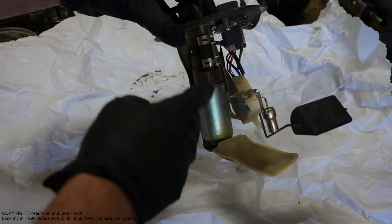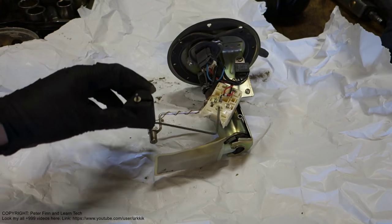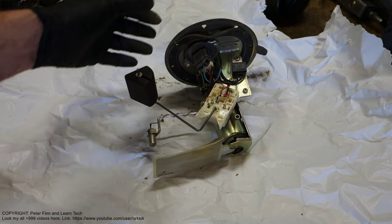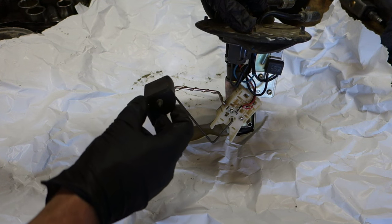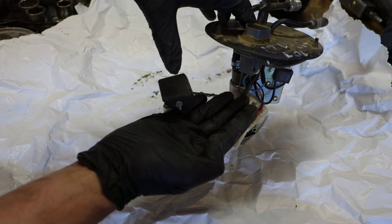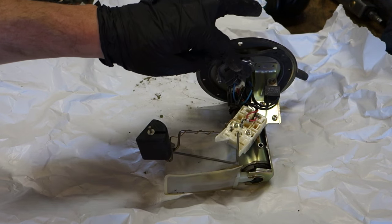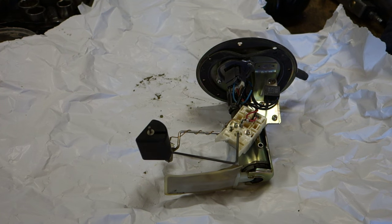Okay, that is the fuel pump, and then what is this? This is really interesting because this part is the fuel tank measurement meter, the sender, in Toyota and any car. When the float moves in our fuel tank, it is always on top of the gasoline level. Like in here, my hand is the gasoline level, and this meter measures how much gasoline we have in our fuel tank. There are a couple of cables that go directly to our dashboard. Let's check the dashboard tank meter next. I will show that to you also.